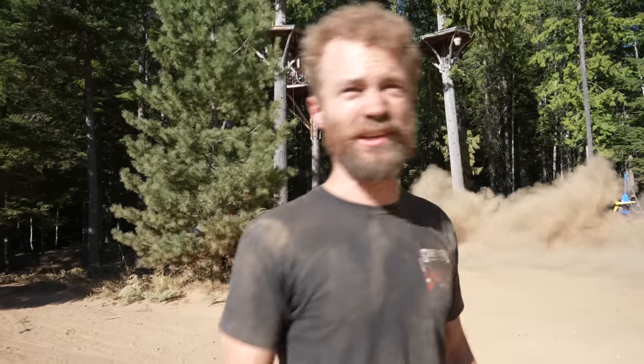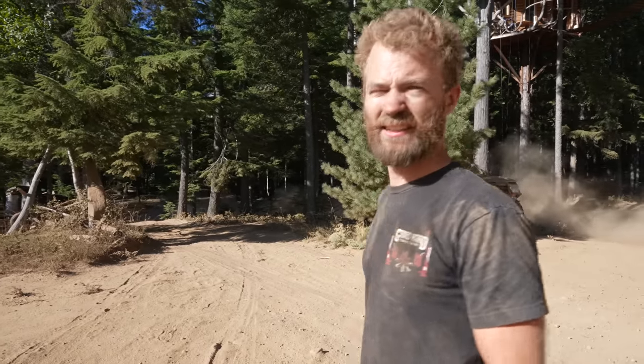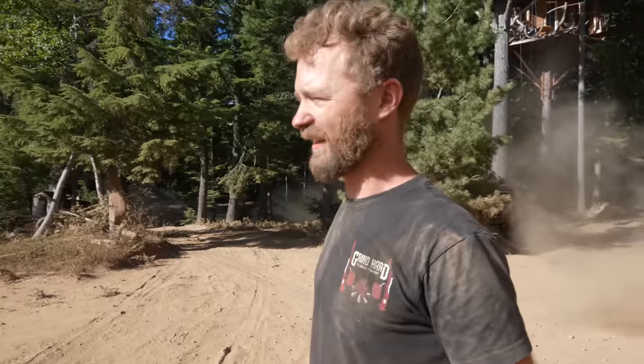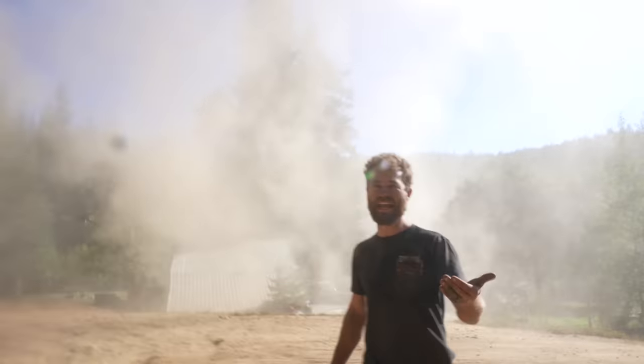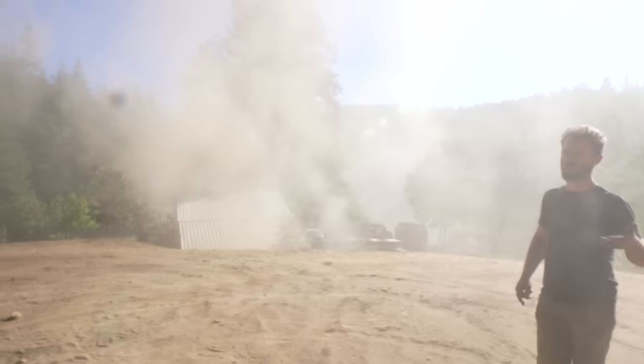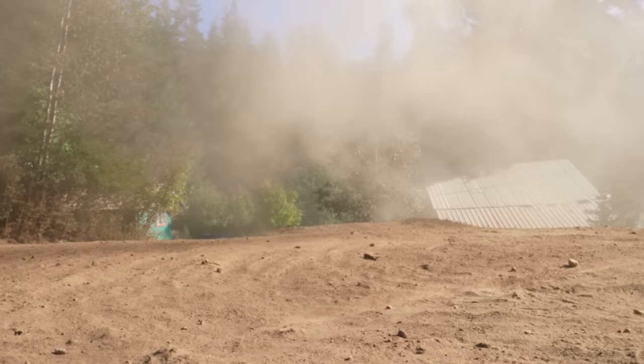It looks so good churning up dust. And all of this, and we can't even rev it past 5,000 yet. That was above 5,000, my ear tach telling me that. The thing is, it's on dirt, and the 5,000 is not a hard limit, it's just that above that, we don't really know if it's safe, because when the tuner was doing his thing, one of the pins didn't match on the ECU, so he wasn't getting info about the fuel map or something. So it's probably fine, and on dirt, it doesn't have enough traction to give it enough load to cause issues.